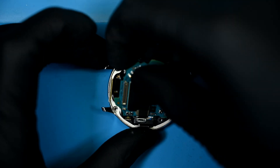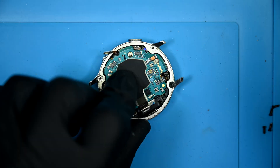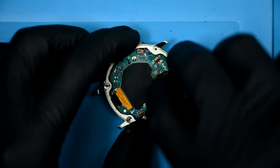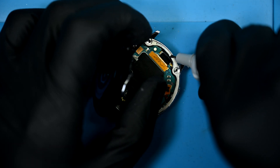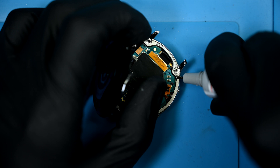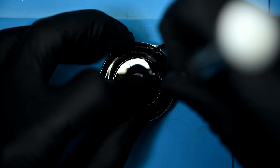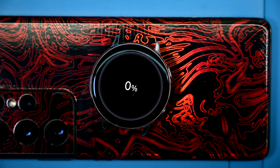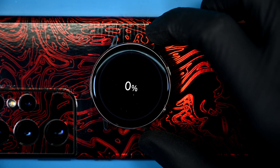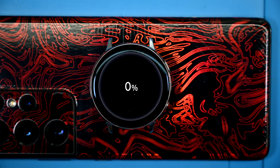Reassembly. I don't have the factory replacement for the adhesive, so I'm going to make do with a different silicone-based adhesive and try to create as consistent of a line as I can. I'll also warn them again that this water resistance should not be trusted. Finally, I'll press the panel firmly down and tighten those four tri-wing screws. After some charging, this watch was back in action. Thanks for joining me — drop any questions below and I'll see you next time.